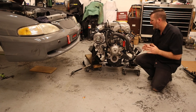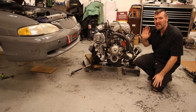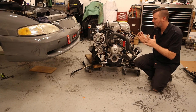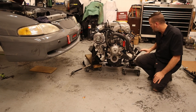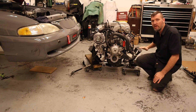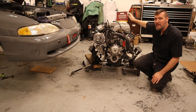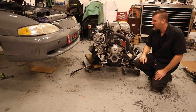I'm going to wrap up the video right here. I still have a few other things to figure out before we can put this engine and suspension back into the car. We've test fitted this K-member, gone through the alignment process, and squared it up nicely in the car. I did modify the upper control arm brackets to fill in the gap we were seeing between the K-member and the frame, so that's going to be all nice and flush now. If you want to see what's coming up for the car — like what's maybe going behind the engine — hit that subscribe button and I'll see you guys in the next one.